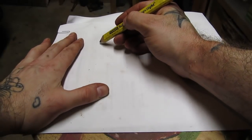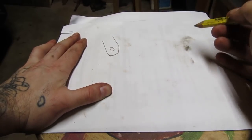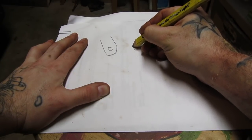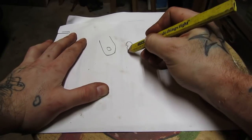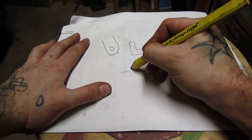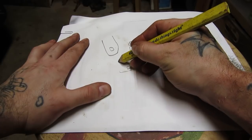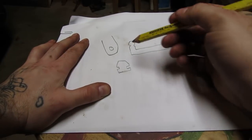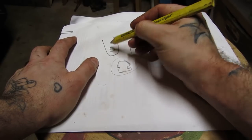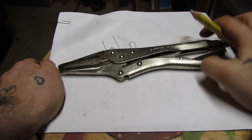I was able to get that in without cutting it — it was a nightmare. This video is probably only going to be like eight minutes long, but I think I was probably under there for 45 minutes. So how did we do it? Let's draw a diagram. Off the linkage side there's a piece with a hole in the middle, and then you've got your bar that goes to the actual transfer case, and that has a fitting on it that looks almost like a grease nipple type fitting. And then you've got your bushing. You're going to grease this whole thing right here — put grease all over that thing and find some way to get this tapered end into here.